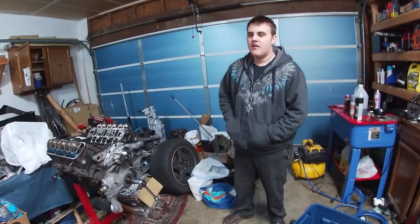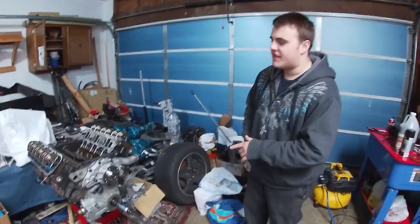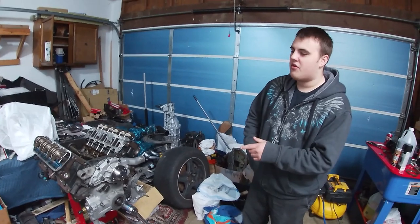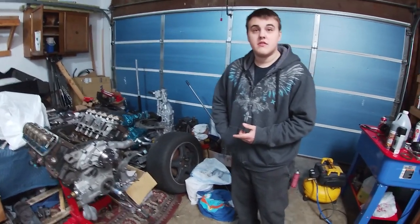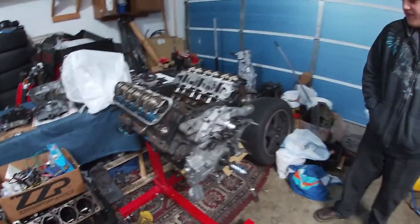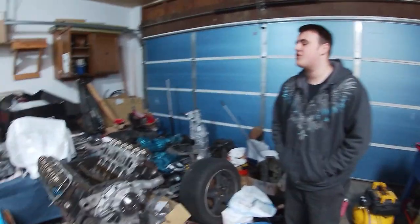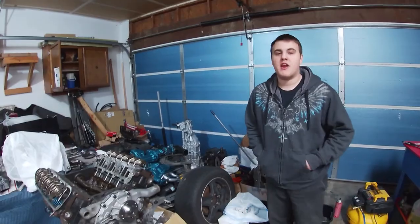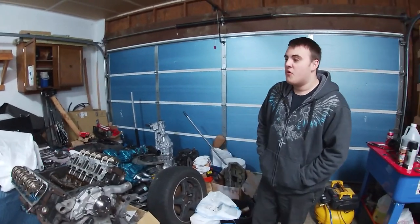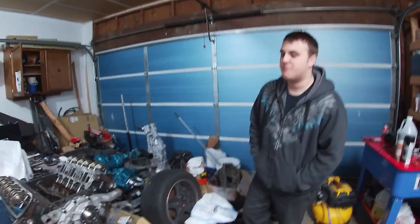Some updates: the Bonnie, as you guys know, this engine is going back together with 90-pound valve springs, LS7 lifters, VS cam, and bumped-up compression because this is a Camaro engine. She's also getting two brand new axles, GXP brakes — I'm rebuilding a set of front calipers — brand new rotors, brand new pads. I've been wanting those V8 brakes on my car for a long time.